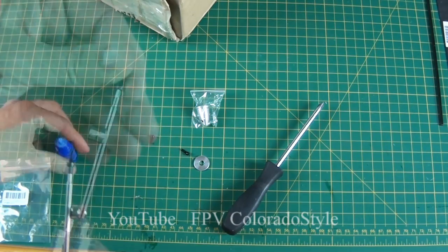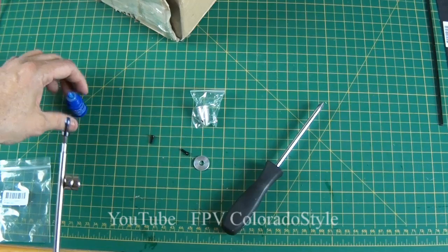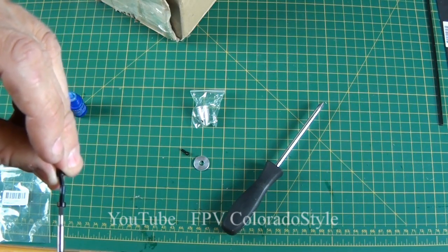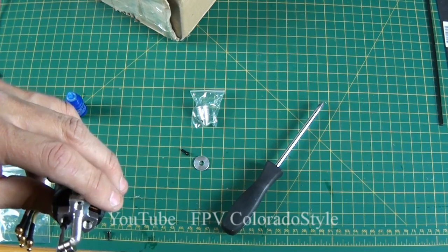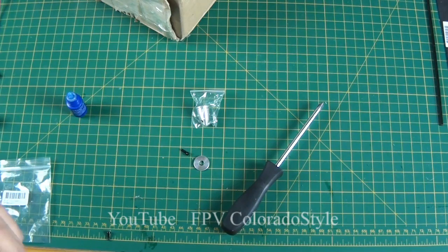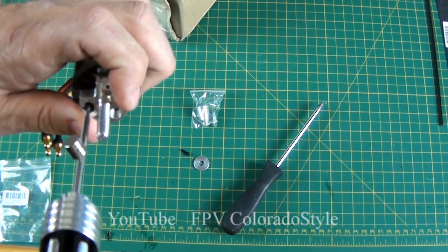If you see right there, you can put neodymium magnets on that — it's a great way to hold your screws in place while you do this. I put too much Loctite on there, so I'm going to take another screw and rub it off. Again, you don't want this to go down inside the motor — it's liquid plastic and it would definitely mess up the bearings. Nothing too overly exciting on the torque: 10, 15, 20 pounds. Nothing huge — let the Loctite do its job.